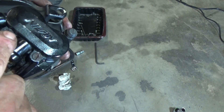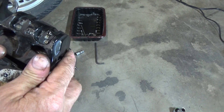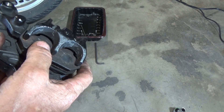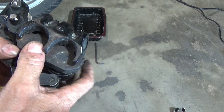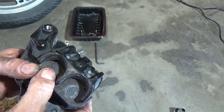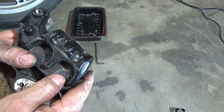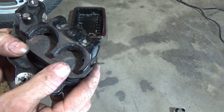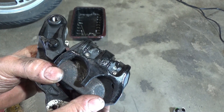To get these brake shoes off I've got to get these two screws out, and they could be tricky. When I had this off the other day trying to free it up before I ordered the kit, I had to press the piston in with a C-clamp really hard, then pump it back out with the hand brake, then push it back in with WD-40 sprayed on those two pistons. Finally it started to move more freely, but it's still way too tight.